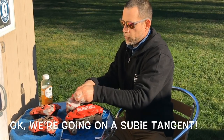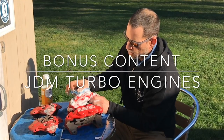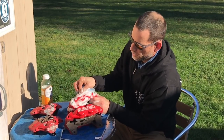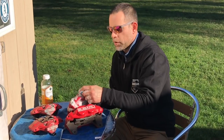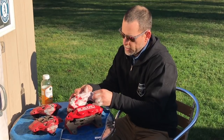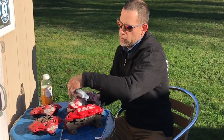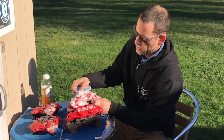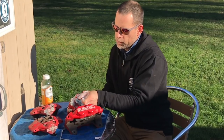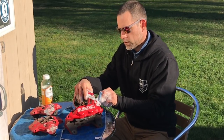The '94 Impreza and the '93 Legacy are both OBD1, and they went to OBD2 in like '96, '97 in the US market. But they stayed OBD1 in the Japanese domestic market up until the early 2000s. So all the engines you get from Japan are going to be OBD1 all the way up until sometime in the early 2000s. So if you want to buy a JDM motor and swap it into a US model — here in the United States we didn't have turbo Subarus, really. We had the Legacy turbo for a couple of years in the first-gen. We definitely didn't have the first-gen Impreza with any turbos — we didn't get the turbo Impreza until the 2002 Bug-Eye, and we didn't get an STI until 2004. But the European market, Australian market, and Japanese market all had the first-gen Impreza with turbos, STIs, the RA model, and all these special edition models all through the early and mid-90s.